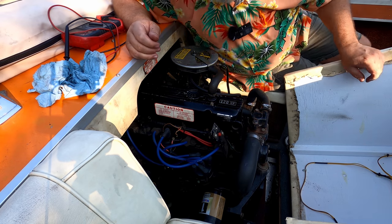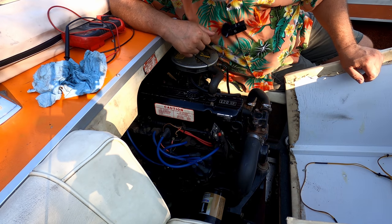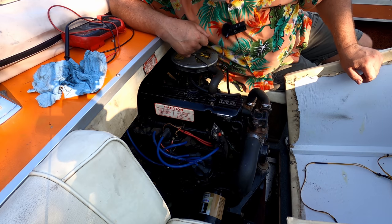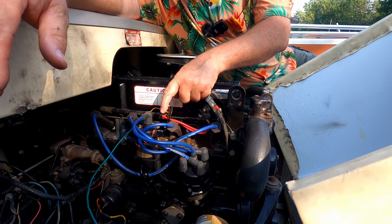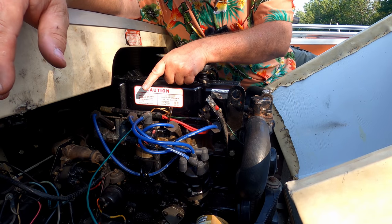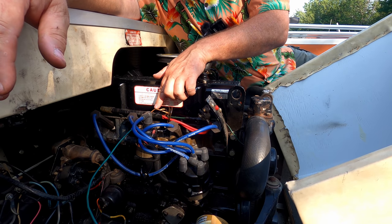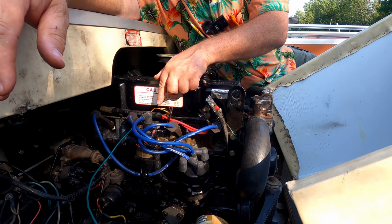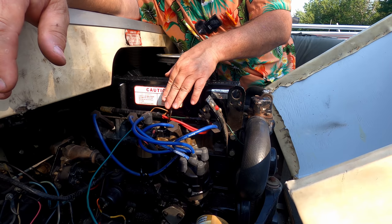I'm not sure it was the wrong one. Oh, it's just that there's no loop to go through. Right. So now, brown wire. Now I just need to run a hot wire to that thing and it'll be 12 volt and I'll be golden. Yeah. Alrighty. So I saw that this brown wire here came off of the starter solenoid, off the starter. So the darker tan, darker brown of the two. I thought, well, that's got to be my hot wire for the start. So I snipped the light tan wire.